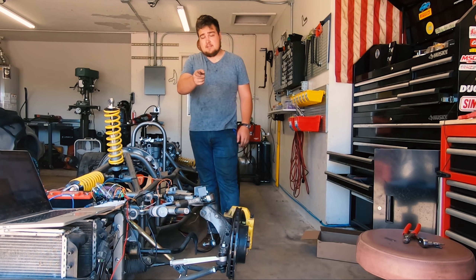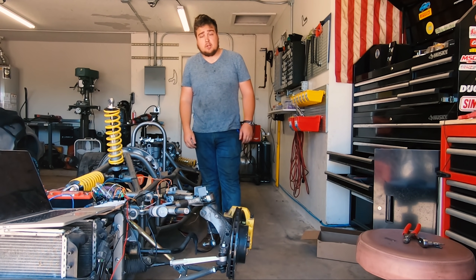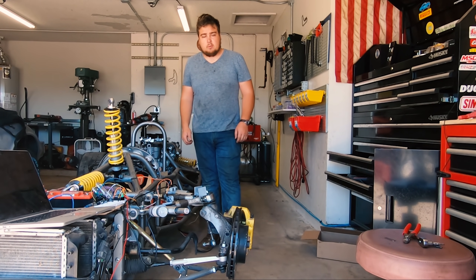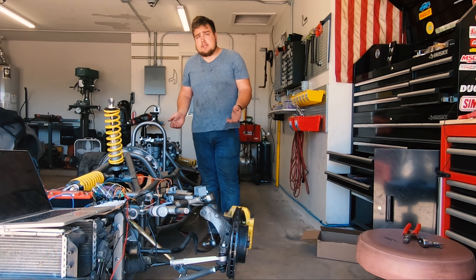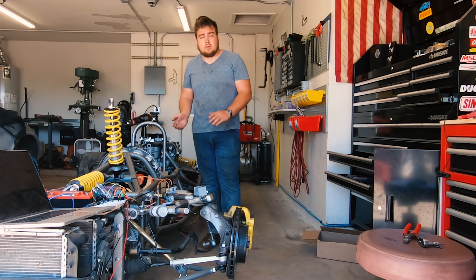This accomplished exactly what I wanted to accomplish today — for it to move back and forth and to test how well it actually functions. I really like those senders, and if I can put it into a smaller package I think it'll work pretty well. I absolutely need to do the steering, which is actually the Mercedes DAS system, and I'll tie all of that in along with a position sensor on the steering wheel. With all of that tied in, I can control the toe and the upper A-arm by sensor data from the steering wheel and suspension position, and start to build a program that will probably be a little bit adaptive learning to what works best.